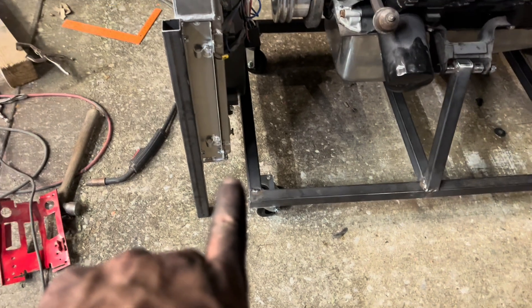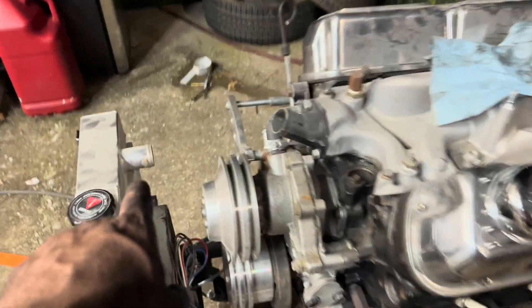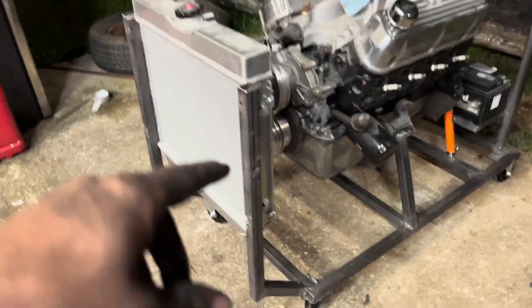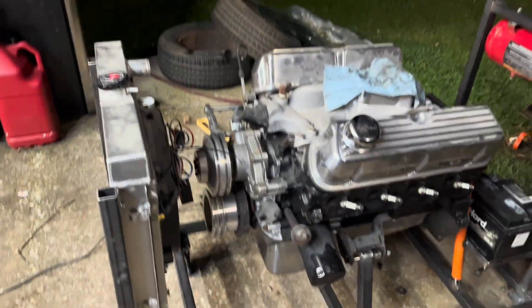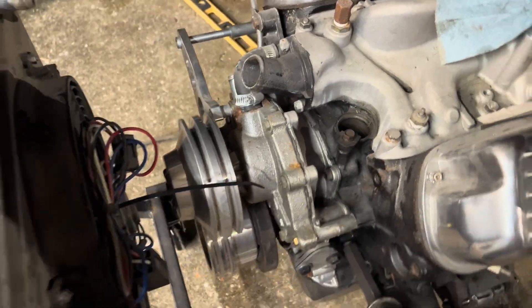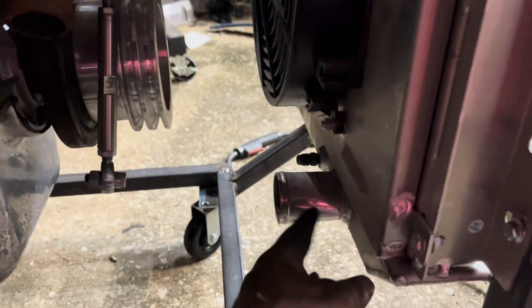Now I've just got to make my brackets — I'm going to do a bracket from here going up at an angle to connect to this so that my radiator gets a little more height to it so I can easily connect those hoses. I got the radiator mounted — it's on there really good. It sits out five inches from the stand, plenty of room between my engine and my cooling fans. I'll have access for my radiator hose to go straight down in here, and from this one here go into the alternator side.